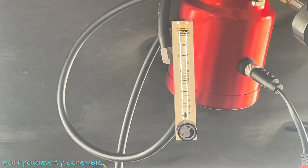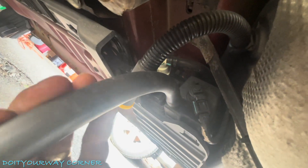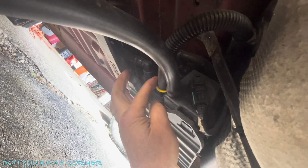So what I want to do is go to the back and actually remove the plug I have on the canister just to show you — basically expose the leak so you can see how it'll react when we disconnect those connections. So we're into the car. Let's see if we can find that canister. Here's our tank — everything that looks silver — here's our canister. Really tough to get in here. Here's the line that comes out of the filter. Basically, this is what filters the gasoline fumes so that it's not exposed to the environment. I plugged off both sides. This is the hose that would have been connected to the canister — I just took a piece of hose and plugged it up. So this is sealing off the system right now, and this side is just going open air.